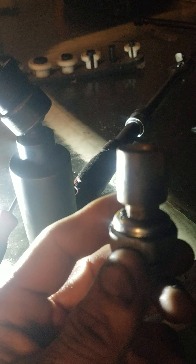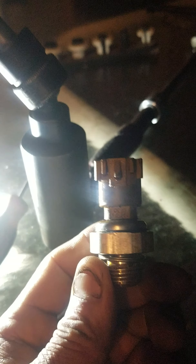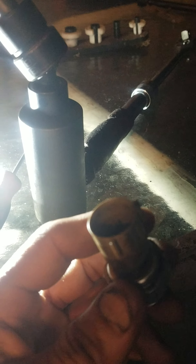They have special tools for this, but when I put the special tool in it doesn't fit exactly right. The inch and 1/16 socket fit perfectly. As you can see, oil came through — I guess the seal — and when it does that it makes the sensor go bad and you won't get a correct reading on your oil pressure.